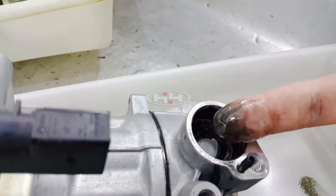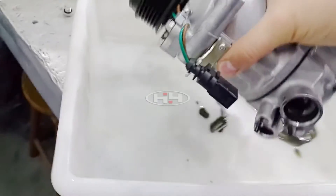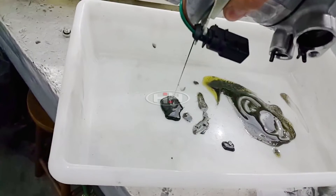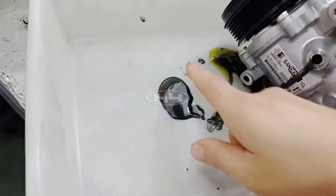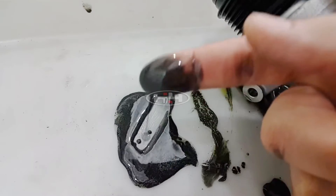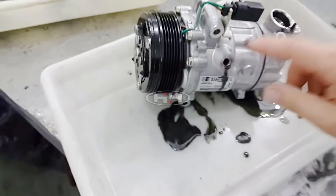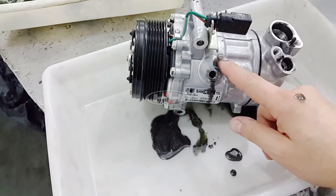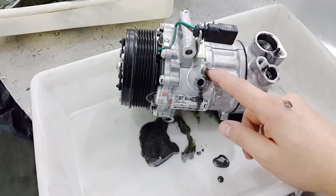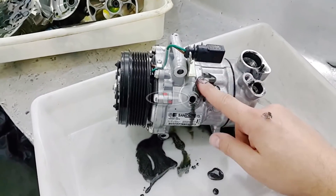When you do put on a new compressor, if it does have the full amount of oil — this is like a quarter ounce — and if the whole system has five ounces, it's all up in the evaporator. If the new compressor has five ounces, guess how many ounces you have inside the system? That metal flake — isn't that beautiful? Don't we love to see this stuck inside our system without flushing it. And that is what it looks like.